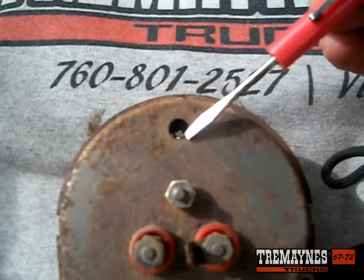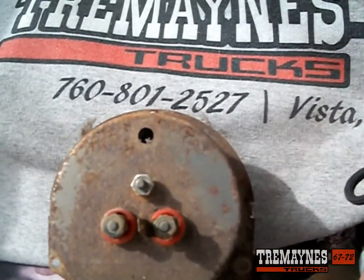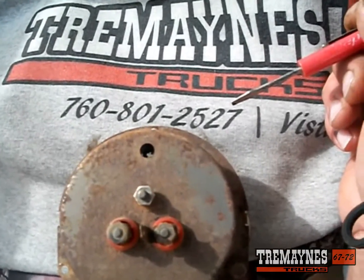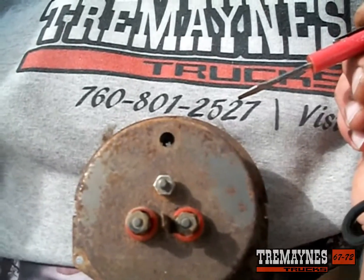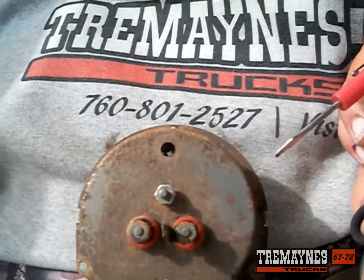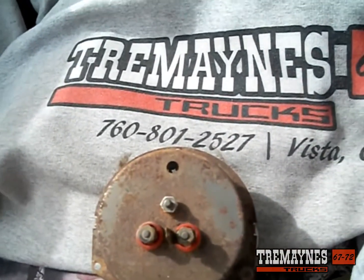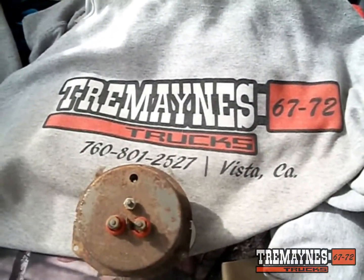Get your screwdriver in there — there's a little Phillips head adjustment in there and it's very, very sensitive. That's how you adjust your tachometer to get it set right. These truck tachs were meant as a tool for running PTOs and dump beds — they're not for racing purposes, these were work trucks. So your tach is probably not going to be 100% dead accurate, but they look cool. There you have it — that's our gauge cluster swap, install, and upgrade to a tach and air pressure gauge.